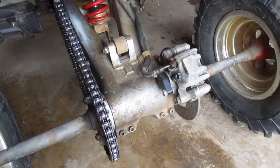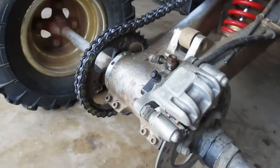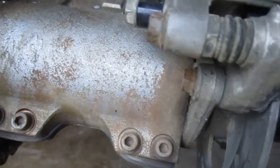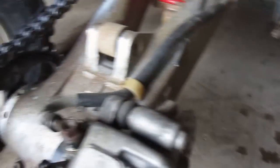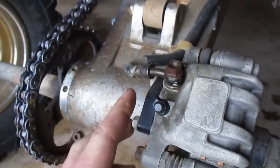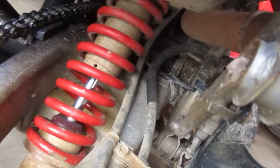It could just be luck, but I think it's due to how much smaller it is. What you will need for this is a 450 caliper, the 450 rotor, 450 rotor hub, and also the caliper bracket in behind. Your factory brake line will work, and banjo bolts will work. The only thing I had to do is up here — trim back some of the outer coating off the line so I could slide it further through that grommet, because otherwise you'll have a bunch of line hanging out back there since the factory 400 caliper bolts toward the back for the banjo bolt. You just slide it up and put the slack up inside.